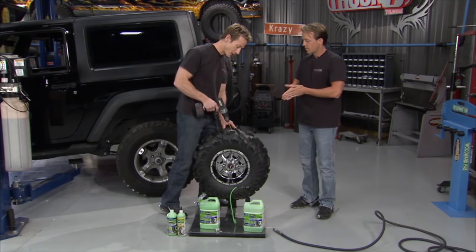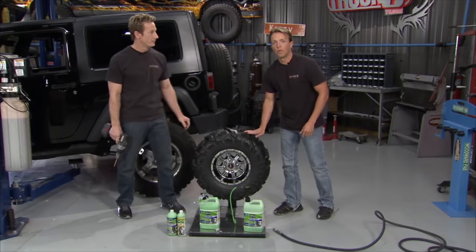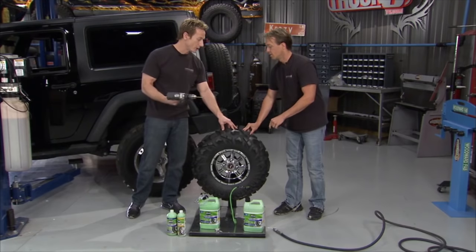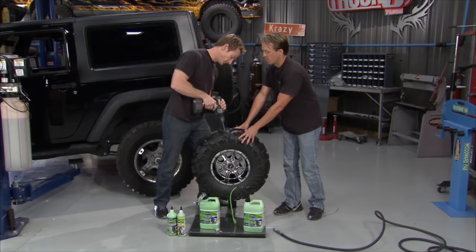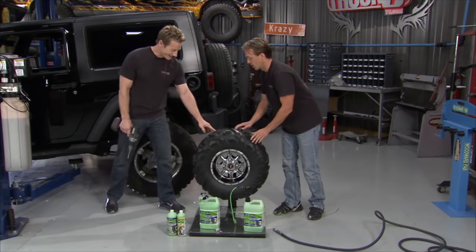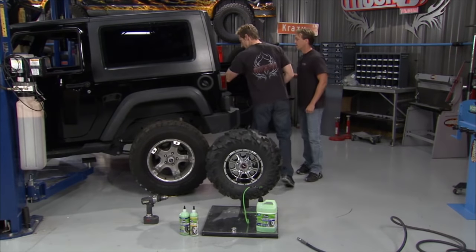Let's say you hit the same spot three more times — multiple leaks. The slime seals each one up. You can hear it leak and then it seals. Big thick cactuses all over the place, and the tire just seals right up. Boom — slime, tire's fixed, we're rolling down the road, we don't even know we have a flat. You don't have to use it just as a preventative; you can do it as a repair as well. If you didn't put slime in ahead of time and have an issue on the road, you can do it afterwards, fix the problem, inflate the tire, and you're good to go. Slime is safe on all wheels and will not corrode.